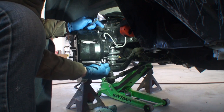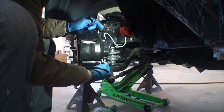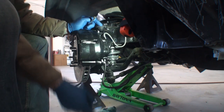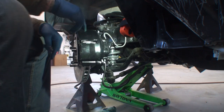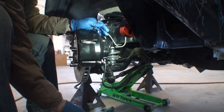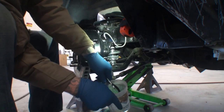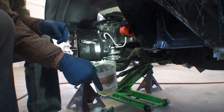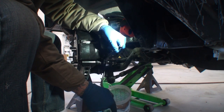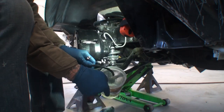Minnie is going to pump the brakes up — five or six good pumps. Remember, we already filled our cylinders with the syringe starting from the bottom. We should have minor air coming out. I've got a cup here with my hose in it. She's holding the brake — I'm going to open the bleeder. There was no air in the line at all. So I'll tighten that up. You can let off the brake now. No air at all in that one.